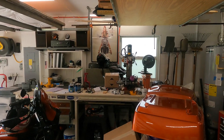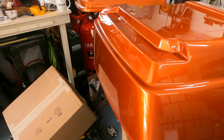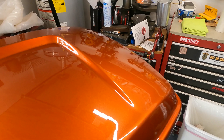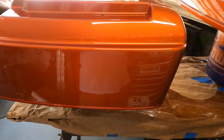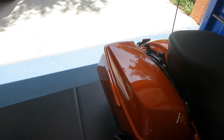Okay, we're back — the paint booth is torn down with all that nice orange dust. Here we are with the clear coat on it. This is dry pretty much but it has not been sanded or buffed yet. I am going to do a little sanding on the clear coat before I buff it — there are a few spots of imperfections. But all in all I think it turned out pretty well, considering I've never done a three-stage paint job like this — base coat, a fairly close color match to the white spike.